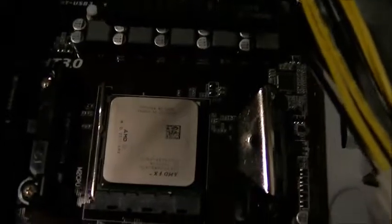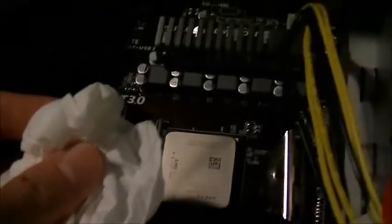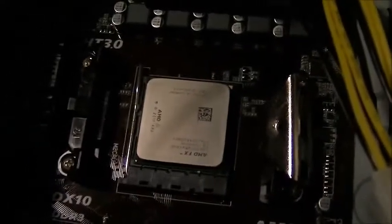Before I did all of this, my CPU had all the thermal contact on it. That is just some grease. You can take just a tissue. I know, don't be afraid. The little particles won't do anything. Just waft away any if you see any. And what you do is you do circular motions and then linear to rub it down and make it nice and good and clean.